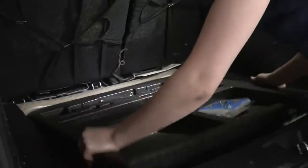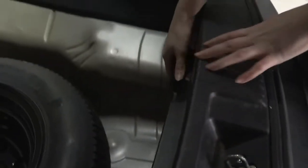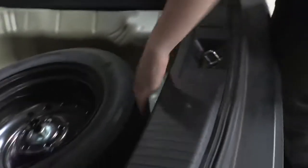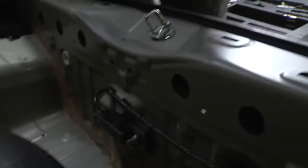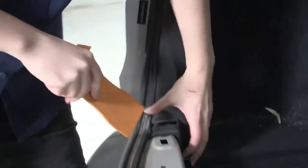We're going to remove this foam roadside kit holder. And now we can access the panels that we need to remove. So on this vehicle we're going to remove this lower trim panel here. Just by lifting up — we have four clips beneath this, two on this side and two on this side — so if we just lift straight up that'll come right out. Next we're going to get this interior panel out of the way. I'm going to use a few trim removal tools here.